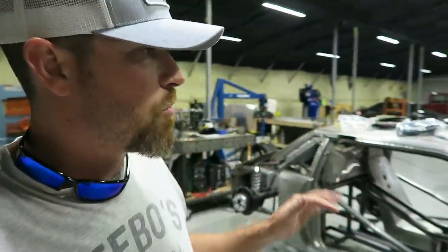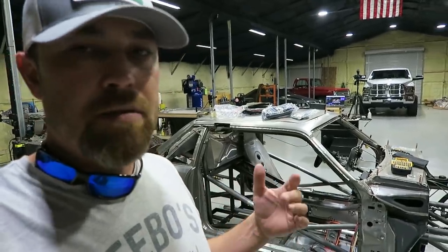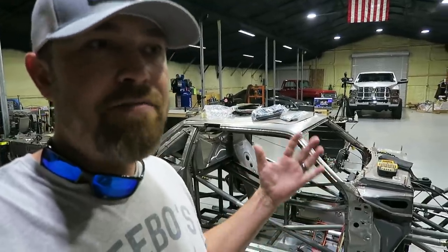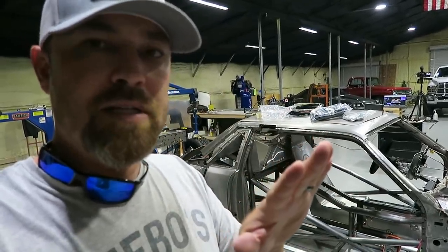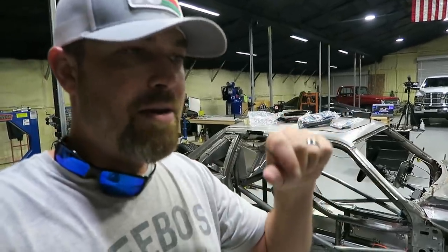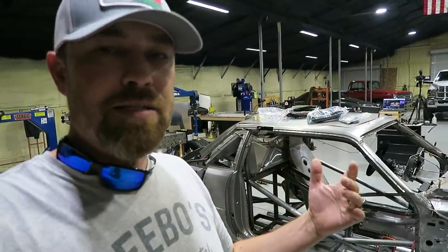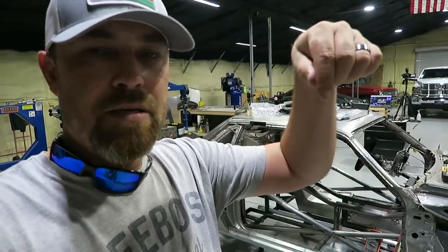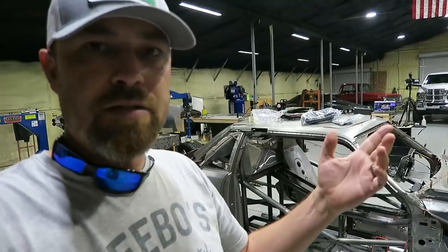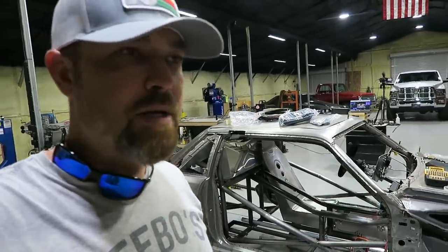What you're gonna find is when you're putting this thing together, wiring it the way that you want, never fails, you're gonna need to add things. And typically it's not just one thing. You end up having to add five things over time. So instead of splicing into a wire, you have these distribution blocks where you have a bunch of stuff plugged into them, and then have a key. I'll write down on a piece of paper, terminal one is X, terminal two is X. It's easy for me to go back and look and say, oh, okay, I need to plug this two-step wire into the trans brake wire as well. So when I'm on the trans brake, I know that the two-step's gonna be on. You can basically just tie that in on the distribution block and you're not trying to splice into a wire, cut something or whatnot. And then you can run that whole bundle over to those blocks.